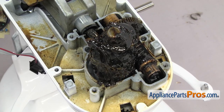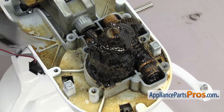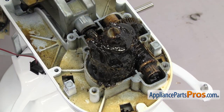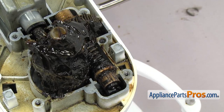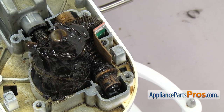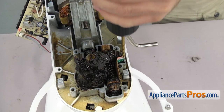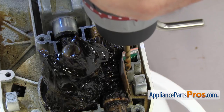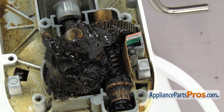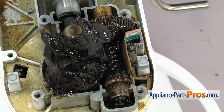If you're replacing the old style plastic housing, look at the holes on each side where the locating pins go. In our case they broke off and are stuck in the holes. One has a little flange so we can get underneath it with a razor blade, but the one on the other side doesn't, so we're going to have to drill that out. If you have to drill out a locating pin, put a little shield to protect the grease so particles don't contaminate it. Then grab a drill and an eleven thirty-seconds bit and carefully drill it out. Once drilled out, clean up the area and the lip around the transmission housing and remove any grease so we can put the new housing on.